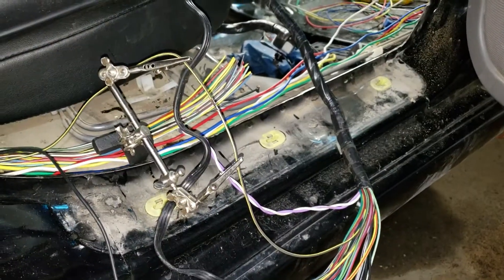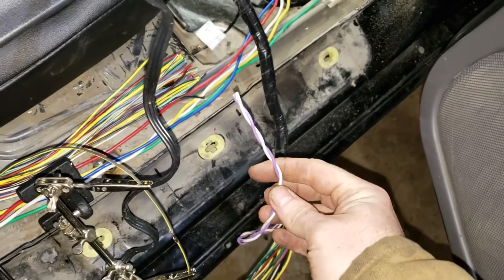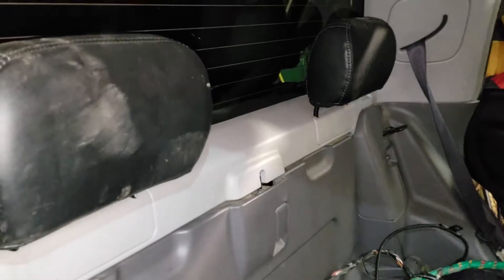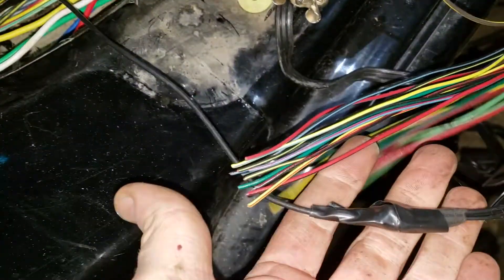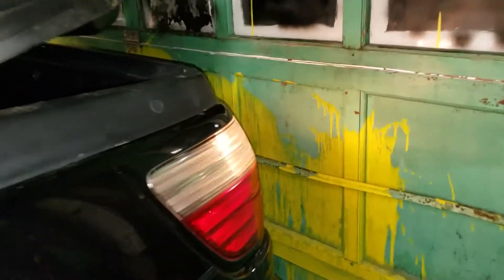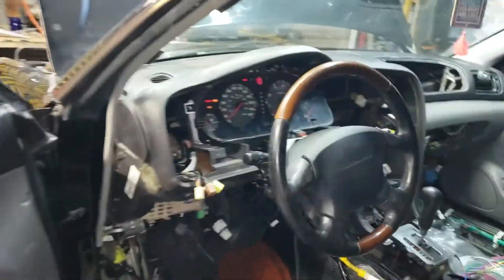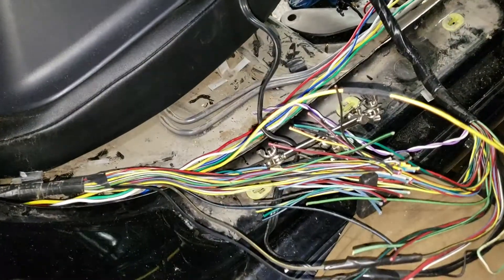That's all you're doing when you're merging a harness — just taking it over and over. There are about 28 wires. This one is for the McIntosh subwoofer — I'm actually going to reroute it underneath the driver's seat since there's no place for it in the back of the Baja. The grounds have a really large connection that took quite a while to solder, but from that work we now have reverse lights. Put it in reverse and the reverse lights come on — they're a little dim because it's a junk battery just used for testing.